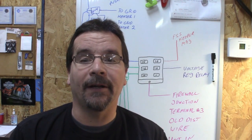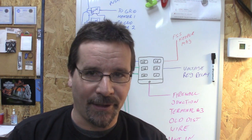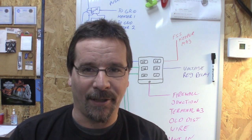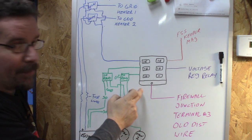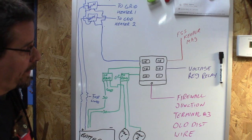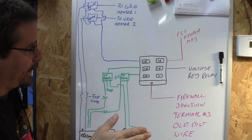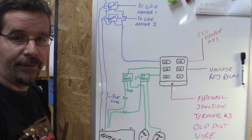Okay, now for everybody's favorite part — the third grade artwork. I know it's crude, but this is not an art channel, this is an automotive channel, and it gets the point across. It shows you how to wire this stuff. So let's get into this. Let's start with the fuse box here. Nothing too extravagant — it's a universal six-circuit ATO blade fuse box that I got from O'Reilly's. You can get it at any parts store.